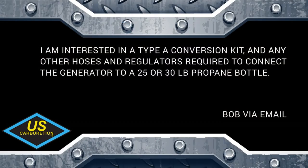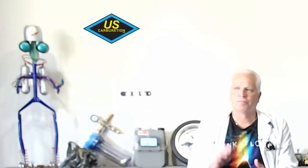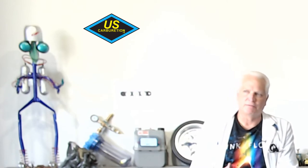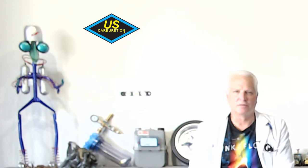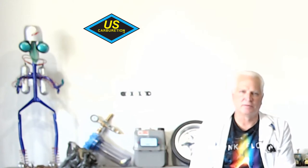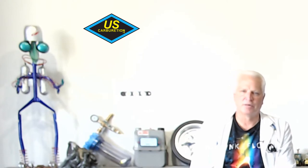This is from Bob. Hey, Bob. Email: I am interested in a Type A conversion kit and any other hoses and regulators required to connect the generator to a 25 or 30 pound propane bottle. Hey, very easy. You can go with the A kit. If you want to save a few bucks, look for our slip tube kit. The slip tube kit fits 90% of all carburetors.